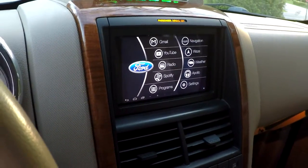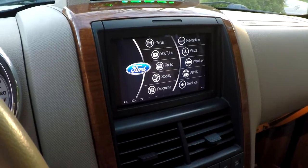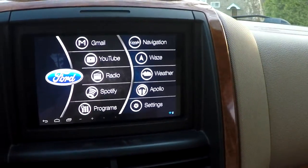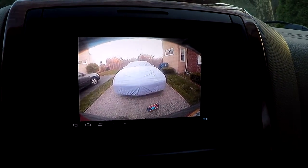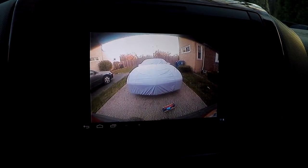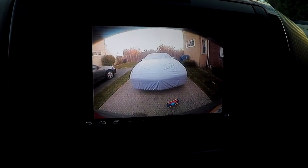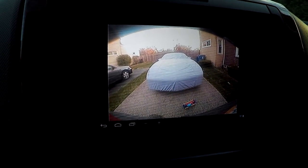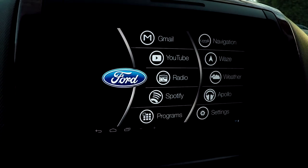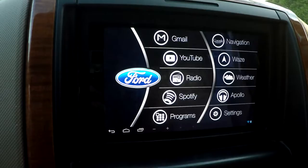Let me do a little example here. We power everything on, get the tablet started up, let the dinging stop, and switch into reverse. After a little bit of a flicker you get the picture. You see that pulsing in the image — that's not normally going to be there; I just rigged the ground up underneath the dash. Once I put a better ground on it that should clear up. Then I go out of reverse and it shuts right off — the tablet is completely responsive at that point.